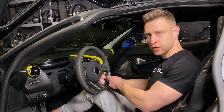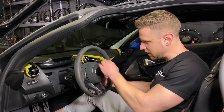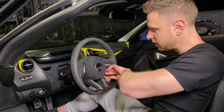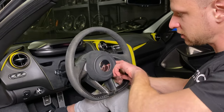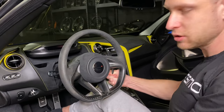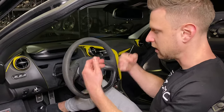Once you've found the contact point where you're going to put the Allen key through, you should be able to feel some resistance as you're moving it in and out. If you're moving it the right way, you'll be able to see that the airbag actually unclipped on one side — on this one it's still good, but here it has range of motion. We've unclipped this side and we're going to repeat that process from the other side and take the airbag right out.